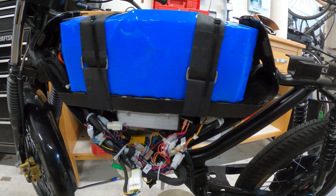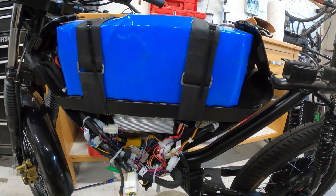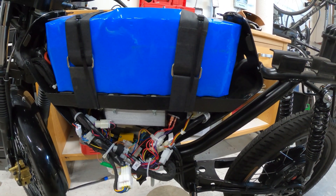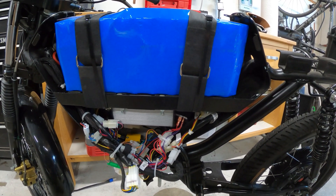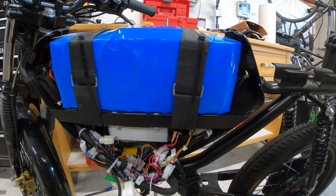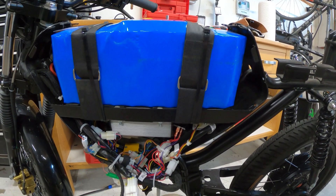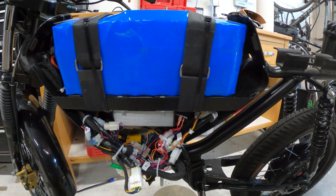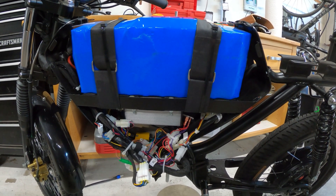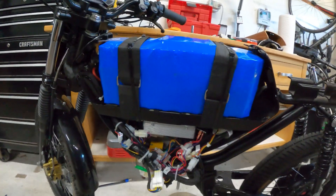That high temperature drops how many amps the pack can output, so I was having cutout issues. It ended up being that I just needed to drop the controller settings a bit. Based on a lot of research on Endless Sphere forums — where people build custom motorcycles with this controller — I came up with 80% for current and 40% for battery amps. That translates to 300 times 80% equals 240 amps peak, and then times 40% which works out to something like 96 amps from the battery. That keeps everything running relatively cool — I've seen my battery max out at about 32°C at this point, which is reasonable.